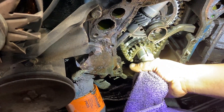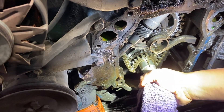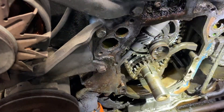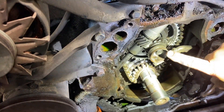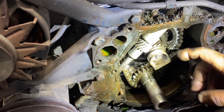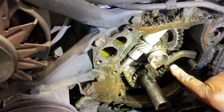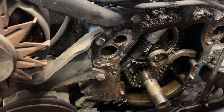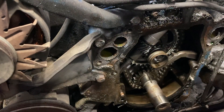Now watch the crankshaft end play. That is abnormal. The reason why this component is also rubbing on that — I can't produce it because I'm not strong enough with the valves and the cylinder head pushing on it — but when the engine is running, this is also going in and out, causing it to rub against the cover. That means the cam bearings are worn and the crankshaft bearings are worn.